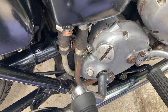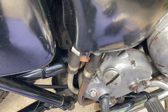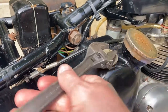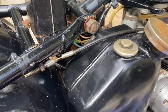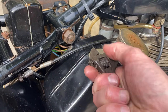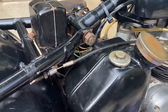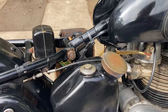It has got like an o-ring in there but the o-ring's not in such bad shape so it can stay. The thing to do is not fall off, because it ain't gonna leak unless you turn it upside down. So we'll just nip that up nicely. Don't have to be mega mega tight. I'm just using an adjustable which is bad practice but it's what I've got. And there we go — that's an oil filter replacement on a 1954 Matchless 600.